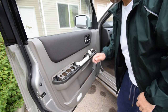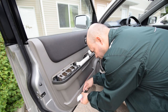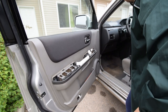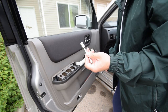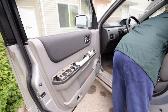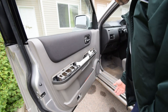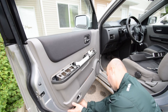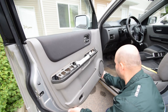For the light, we want to take that off before we remove the panel, otherwise you'd have to hold the panel while trying to unplug it. So go to the bottom here, remove that one - it's a small thing here - pop it off, remove the light. Last thing here, there's going to be four screws: one, two, three, and four. You can use a 10mm socket or a Phillips screwdriver. Once you've got that done, come to the bottom of the door with the panel removing tool - there should be a small dip over here towards the light. Put that in there and pull towards you. Once you get the first one done you can use your fingers and start popping it off.